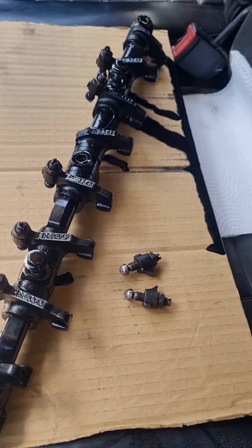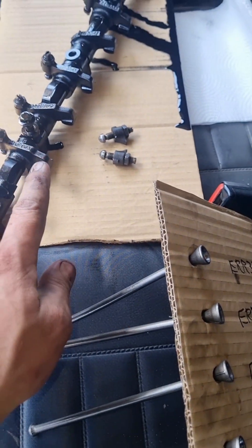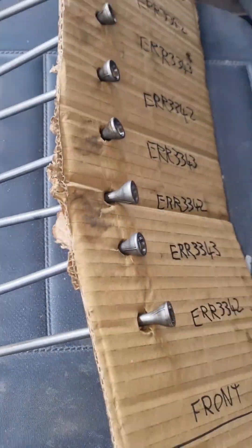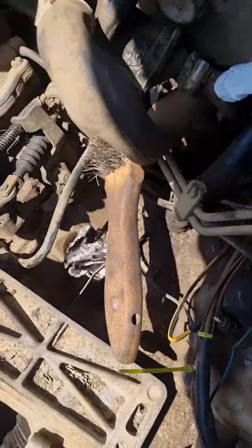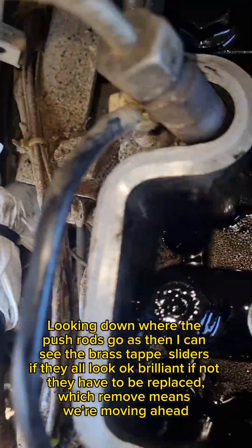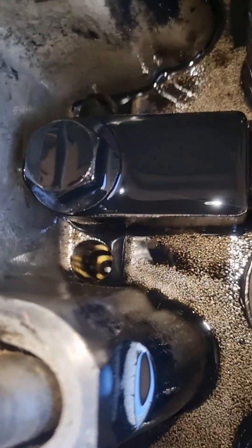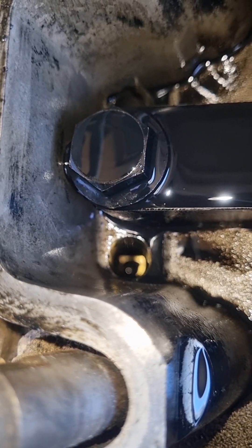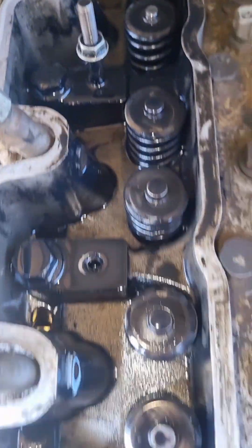Back in the world of James — I've got the rockers off, leaking as you can see. I've got two broken ones. I'll be cleaning them up and looking at them better in a better video. Push rods are laid out in order for the engine. Looking down with the rocker cover off you can see one of the components is slightly deformed, so it's literally going to be a head-off job. Stay tuned for more.